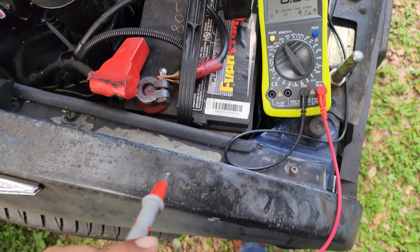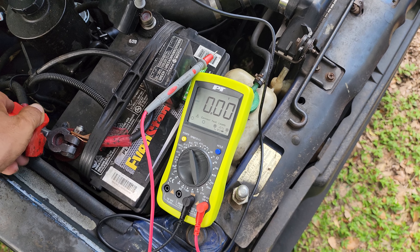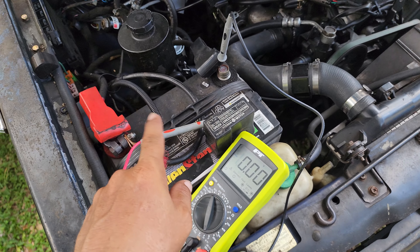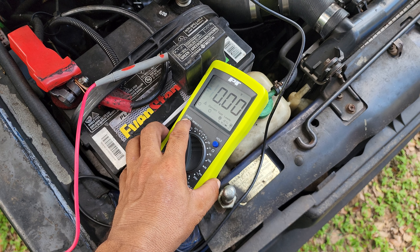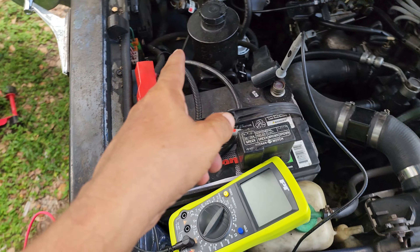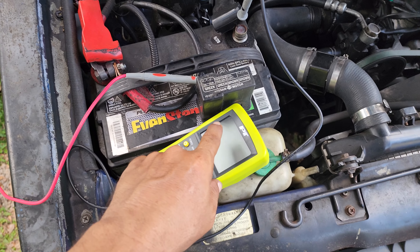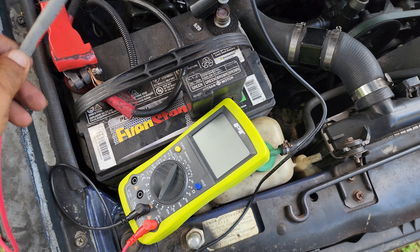And that's just the quickest, easiest way to test your fusible links for power. Your truck doesn't have to be on — your accessories don't have to be on or anything. Your truck can be completely turned off and the fusible links will either read or they won't. If you don't get a reading, it's likely because they're fried and you'll want to replace them. Anyway, just wanted to do that quick easy how-to — I'll see ya.